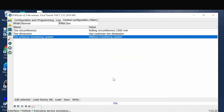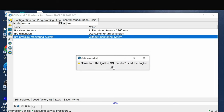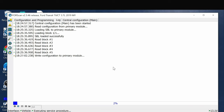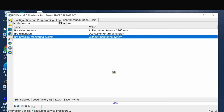We're going to change the setting to 'one: without monitoring system' and click the checkmark for OK. Then go down to the bottom and click 'write' - that saves this to the ECU. A couple more verifications: you need to have the ignition on, click here, and it's going to start writing the configuration information to the module. It will ask about the secondary bootloader - these are calibration files not part of FORScan, so you need either to pre-download those or have an internet connection. It says 'blocks programmed successfully.'